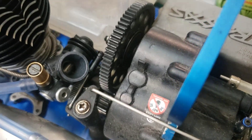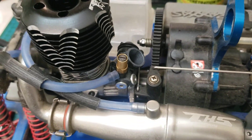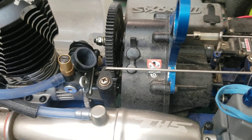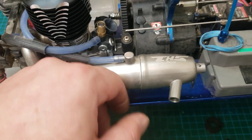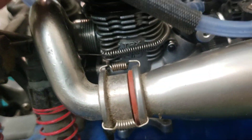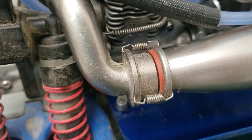This is not actually a Traxxas carburetor — this is a Losi 3.4 carburetor I got from... I can't remember who sent it to me a while back. A buddy from the States who watches my channel — you know who you are, thank you again. And then another guy, I think Dustin, he sent me that THS pipe a while back. These don't fit a 3.3 — well, they do, but you have to use the little black rubber donut funny top-hat shaped gasket in the spring to make them fit. Hopefully that stays sealed up; other than that it's a factory rebuild pretty much.